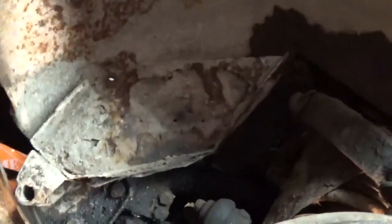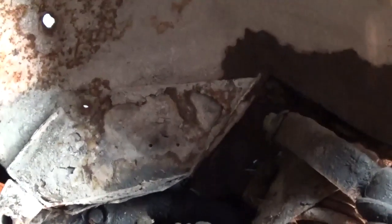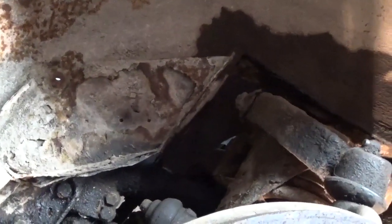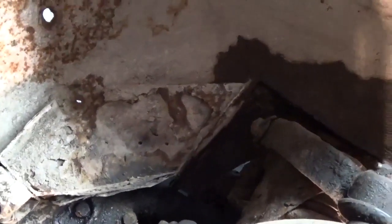Some of these I'm not going to be able to access the cage nut on the inside, so that's probably going to be a problem — we'll tackle that when we get to it. There's a little bit of rust under here. That's the front body mount, and I had to replace that on the 60. It's a known weak point on these cars because the radiator sits right beside it and picks up a lot of moisture. So that'll have to be replaced — we'll have to fab up a part for that because I don't think that bracket is available.